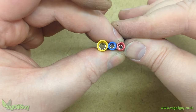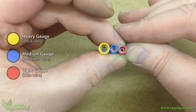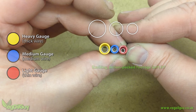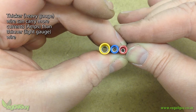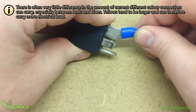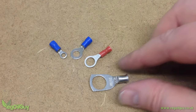Typically there are three colours of crimp connector, and this relates not so much to the size of the fitting, though there can be some differences there, but mainly to the thickness of the wire used. If you look at the small silver circles inside the connectors, this is where the wire is pushed in. The yellow can take a heavier gauge wire, blue is a little less, and red is the lightest gauge. Whilst thicker, heavier gauge wire can carry more current, there's often no difference in the amount of current the connectors themselves can handle. Also, connectors can be wider or have larger holes depending on their use, so bear this in mind when you make any purchases.